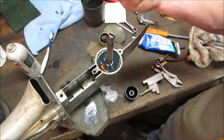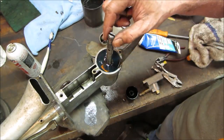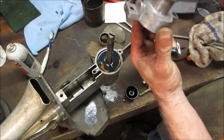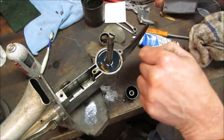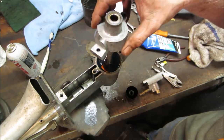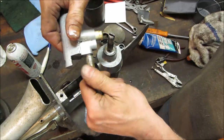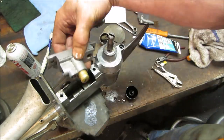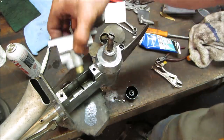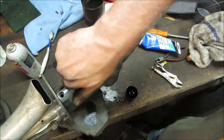Okay, so that one, nothing else goes in there, right? All right. No thrust washer or anything that I'm missing. I'm questioning myself. So the prop will always be turning this way, pushing the shaft that way. So I don't think it would have one. If I do, I'll take it back apart. Get it in the hole. That's that one. This one, we gotta get that out of it. And that's gotta drop down. I almost wanna put a little bit of lube on that cam, but it's just gonna wash it. Eh. Don't know. I don't have an answer. I'm gonna leave her going in dry.